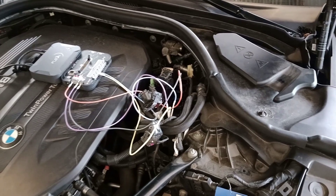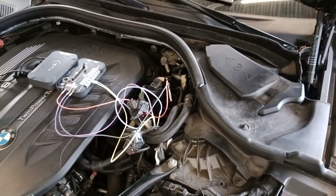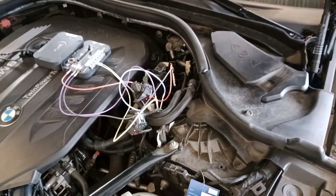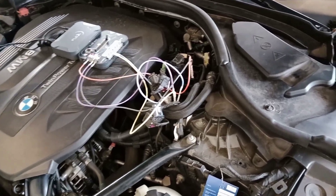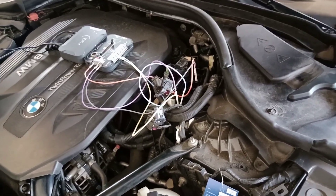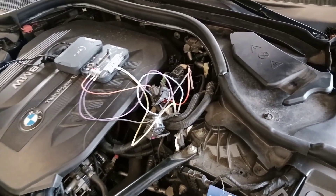This car is quite new and has this protection. When the ECU loses the connection during writing on the MCU, it can also happen that it loses the codings and you will never start this car again — not because the ECU is burnt, but because it's not coded correctly.